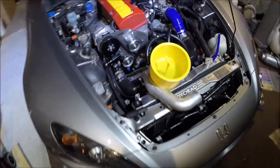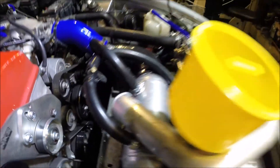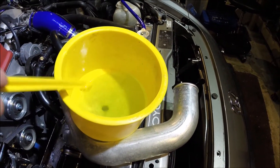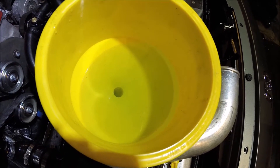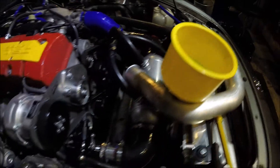The pump is running — you might be able to hear it. Originally I opted for that style of pump, but after taking the car out for a test drive I came back and there was pretty much no flow. The charge cooler system has been bleeding and the pump's been running for a while. As you can see I'm still getting some bubbles, or cavitation, where the bubbles are getting chopped up by the pump. I took the car out once so far and the testing was not good.